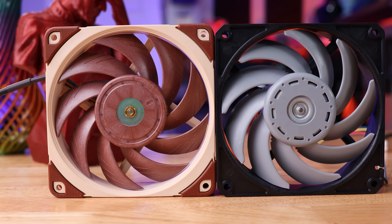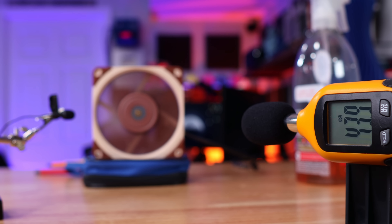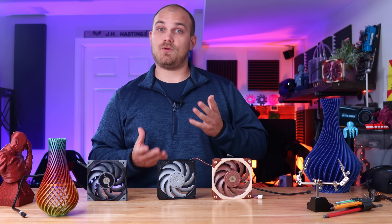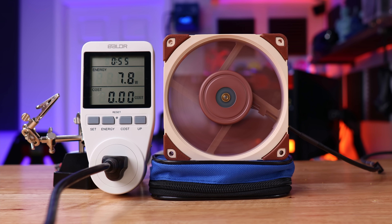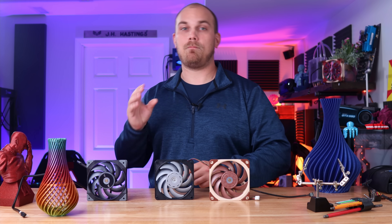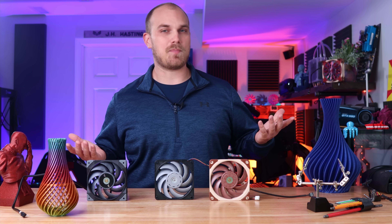In the meantime, let's see if this forgotten titan stacks up to what some call the best PC cooling fan on the market. The first metric we're going to look at is RPM — the Gentle Typhoon does spin a bit faster than the A12X25. In the sound test, the Noctua A12X25 came in at 43.2 dBA, and the Gentle Typhoon came in at a slightly louder 44.6 dBA. Based on what you guys asked for in the last video, we're also doing a power consumption test. With just the power supply running it pulled about 5.7 watts from the wall; adding the A12X25 increased it to around 7.8 watts; and swapping in the Gentle Typhoon bumped it up to about 8.7 watts. So far the A12X25 is slightly quieter and pulls slightly less power, but it also spins slightly slower and probably moves slightly less air.